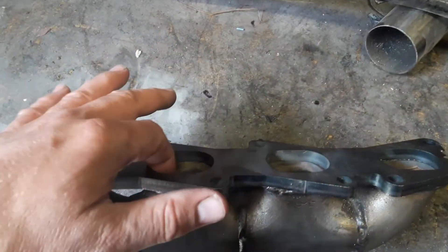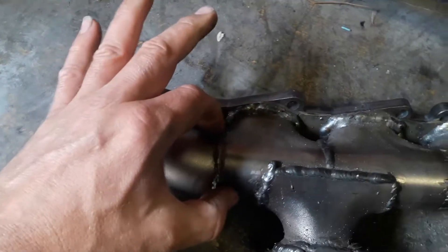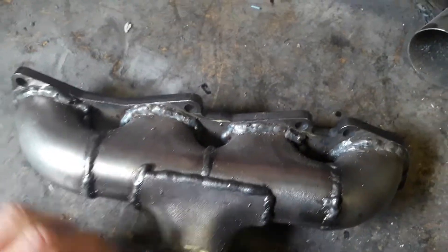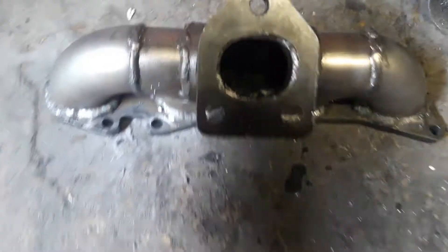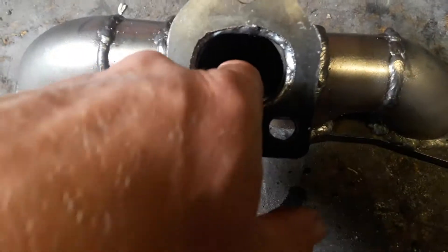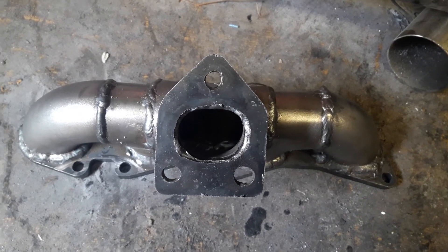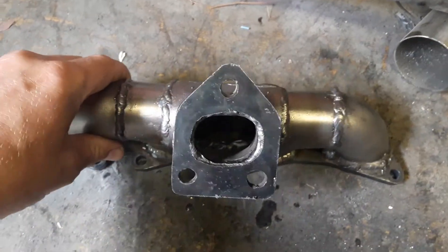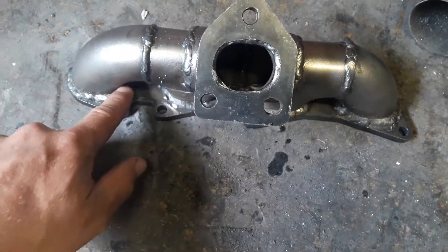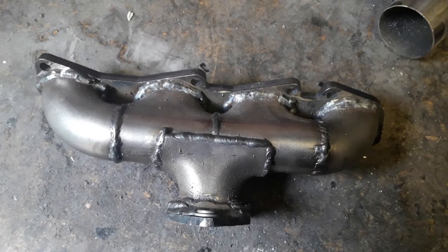There's also some fettling that needs to go on inside the runners themselves. All of these pipes have got steps on them — they're matched up as well as possible, but there is going to be a little bit of a step here and there. Looking inside, you can see it needs fettling, and right inside there's a step which is going to need tungsten carbide bits to clean the whole thing up. The overall process is going to have to be extended to take into account cleaning all of this up and making sure there aren't any nasty steps inside the exhaust manifold. We're nearly there — getting towards the end.